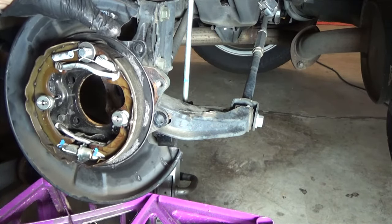I put some lubricant on the contact area — metal-to-metal — there wasn't any from the factory, but there is now from my installation. We'll put the Belleville washer on there — I like it curved up, it's easier to get the pin on. Press it in place and squeeze it down tight. I recently learned that this purple lubricant I've used can affect some rubber types, so I bought one that's safe for any rubber — Buna-N, Viton, or whatever. I'm trying to use up the purple, so you'll see purple and orange — the orange goes on the disc brakes, and the purple goes everywhere else.